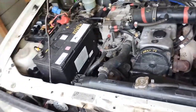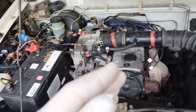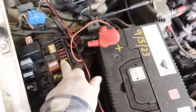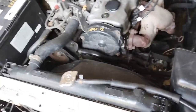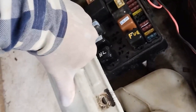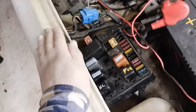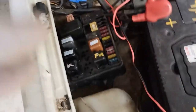I found this out this morning. I had a clue when I started up the car — I heard the fan going at different speeds, then the fan got slower and slower and stopped. I found a burned-out 20-amp fuse. I did test by swapping out the heat and headlight relays — I believe they're the same — but that made no difference. I thought it could be under the fuse box or around this area.